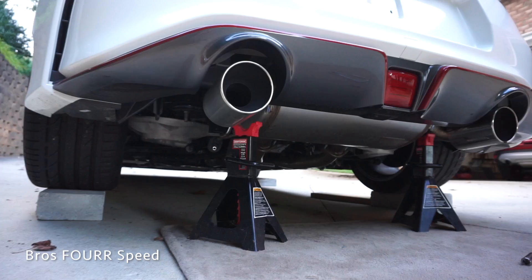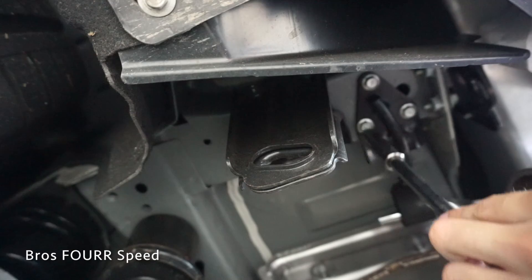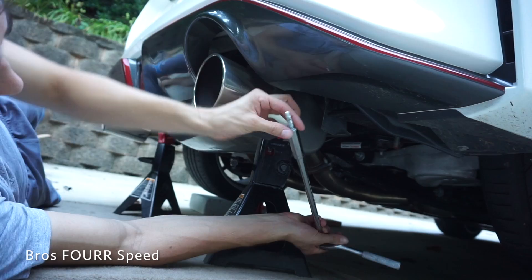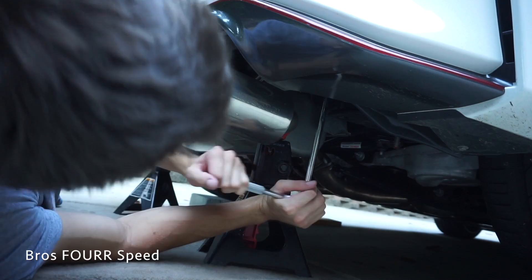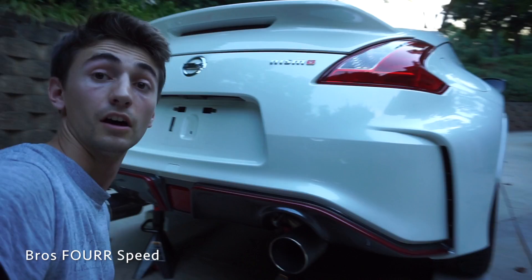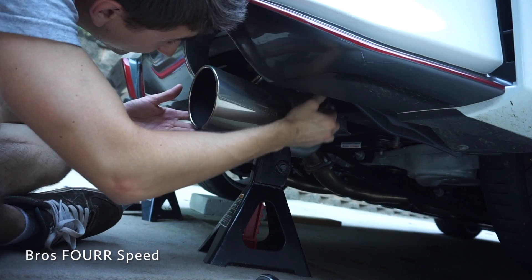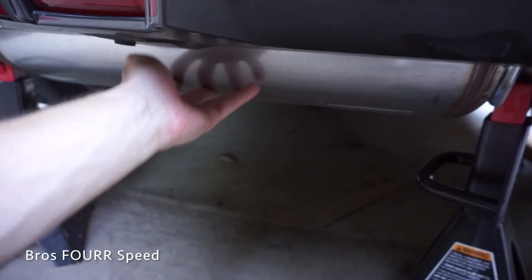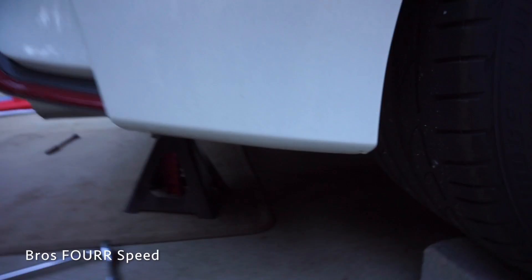With the jack stands in place, once I get those bolts off, the exhaust is going to fall down a little bit — those are just there to catch it. So I'm going to move these jacks out of the way and use my body basically to hold this thing up as I try to wiggle it off. The challenge here is I have to slide it off of those bolts — I got to slide it backwards about an inch, but I don't really have that much room between the bumper and the muffler.